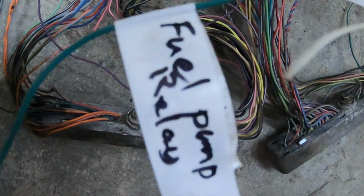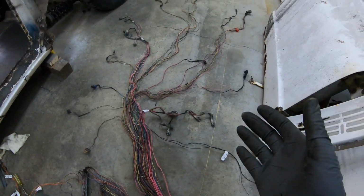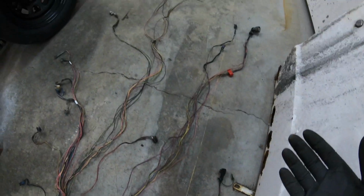And on the green connectors, you should be left with RPMs, your fuel pump relay, vehicle speed, and your engine light. There, that's all the wires removed. Every connector is going to be used from now on.